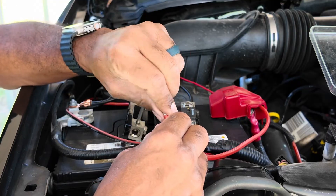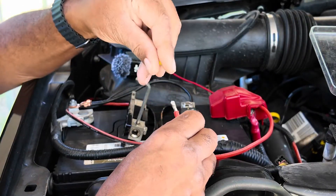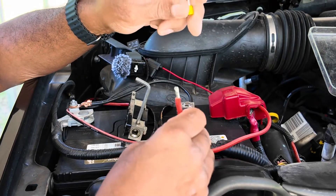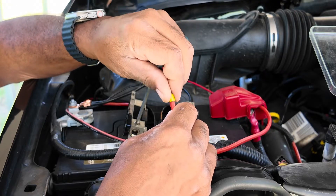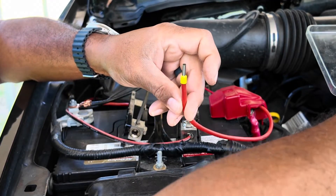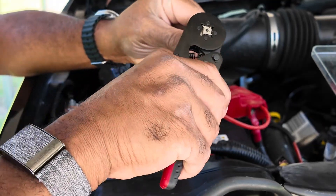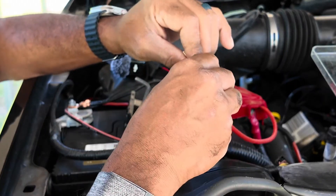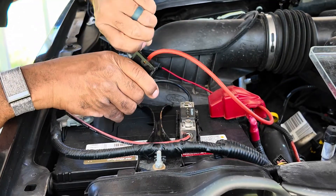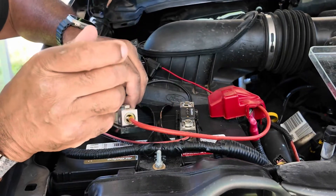I think this one is saveable because I didn't really wrench down on it, and I'm going to use a number six ferrule — I think this is six-gauge wire. There are a few loose pieces there, but I think this is going to do the trick. So I put the ferrule on, give it a squeeze — it's on there. Then take the ferrule and put it into the fuse holder, clamp down on that ferrule, secure the fuse holder, and replace the fuse cover.